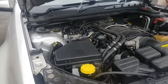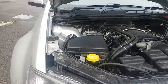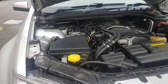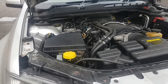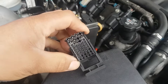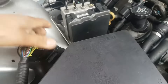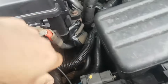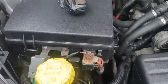Three days later we are back on this. I watched the last couple of clips to refresh myself on where we left off. The reason I said it was starting to look more tricky is because up to now we have nothing pointing to an actually bad O2 sensor - even the heater resistance looks okay. First thing: I've unplugged the connectors to make sure connections are clean. They're pretty clean, pins are really clean. What's left to check is the wiring between the connector here and where it enters this plug.